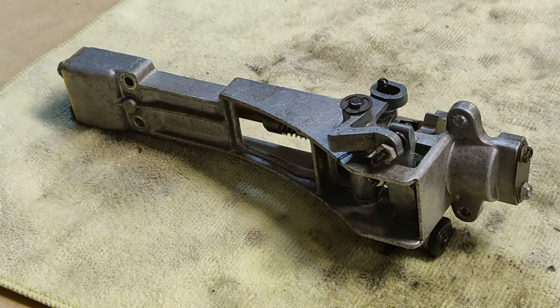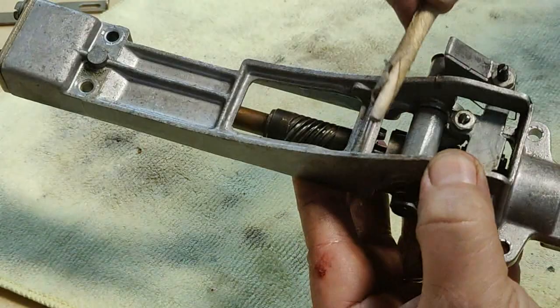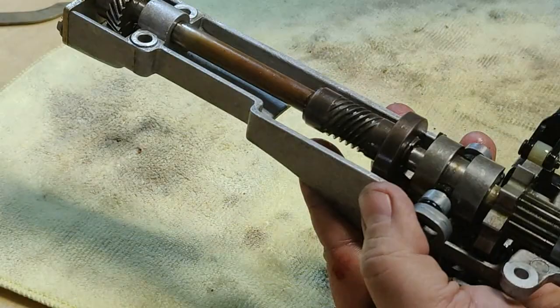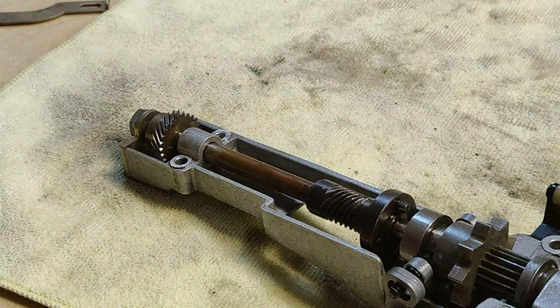All right, we're continuing the reassembly of the clutch. After we've pulled the yoke pin out, actually had to remove it with a screwdriver, kind of cleaned the bore, the hole, with a dowel rod and a piece of sandpaper here. Sprayed everything down, used carburetor cleaner actually, to kind of get all the grime and gristle out of it. Then went back with some light 20 weight oil to kind of oil it up before we reassemble it.